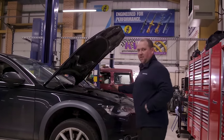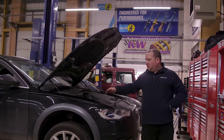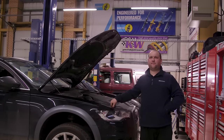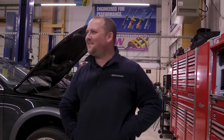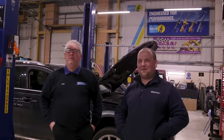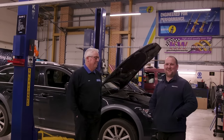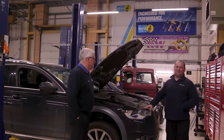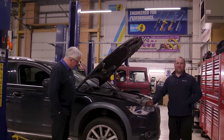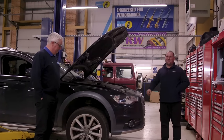We're still waiting for some parts for this A6 — they're on the mysterious back order, same as every other part on the planet. This time it's Audi. The RS6 has come back in — we had the motor out. No panic actually, nothing wrong with it. We just wanted it to be driven by the customer with no undertrays on to make sure there's no leaks. They're over the moon — no leaks, no nothing. So in the morning all it gets is undertrays back on and then off back to the customer. Paul's been on with the G-Wagon — he's got the door stripped down. That's the wiring he's sorted for the power folding mirrors and the adjustment on the mirrors. He's also got the window taped up because the two front windows are really slow to go up and down. We've got two second-hand motors because you can't actually buy the motors for these particular doors anymore, but once we stripped them down, the gearbox is wrong — they're nothing like the ones we've got.